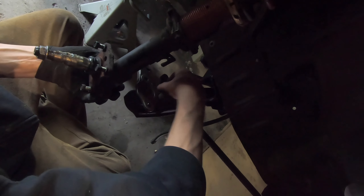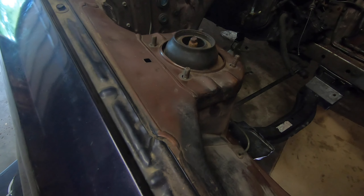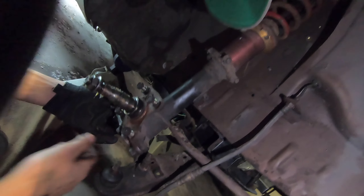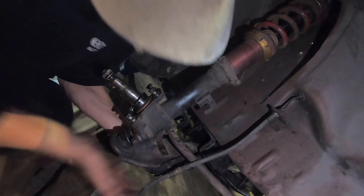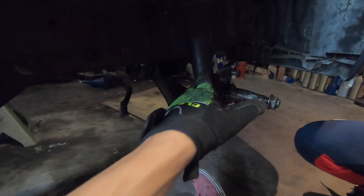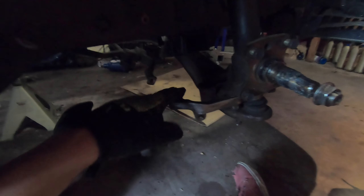Suspension time. I'm gonna get this control arm out of the wheel real quick. The whole shock will probably have to be replaced because I don't know how good this knuckle is anymore. So we have a lot of it all assembled — I have the subframe on, lower control arm is on, the struts on. Now to put the bearings back together inside the rotor hub assembly and then put the wheel back on — after I get the tie rod end on. I'm just missing this nut.